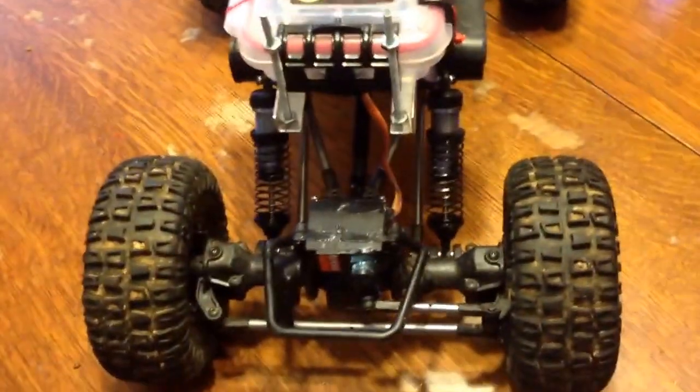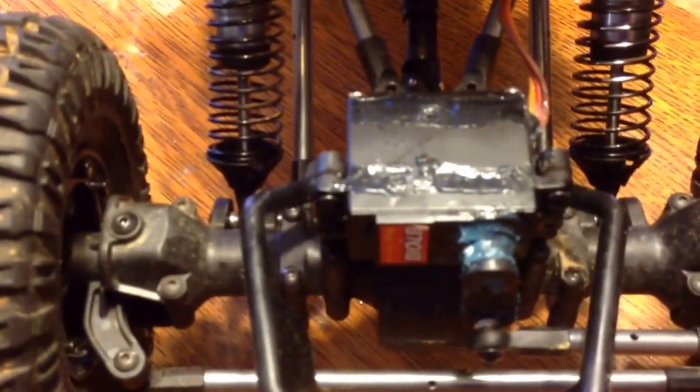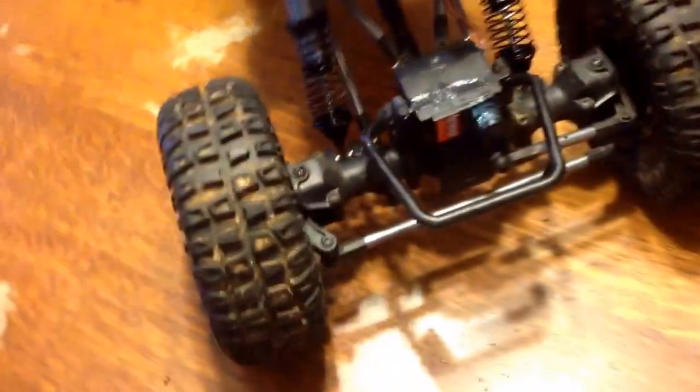That seems to do the trick. I've had it packed full of snow several times now, no issues. Just took a small thing of silicone over the servo there and then just packed marine grease around all the other orifices — the holes in your servo.